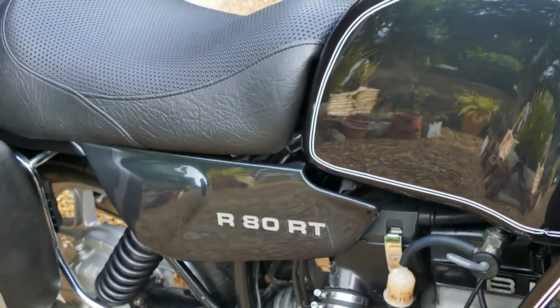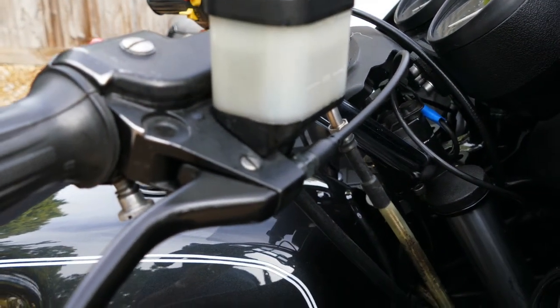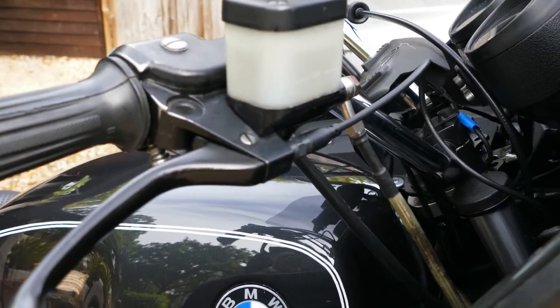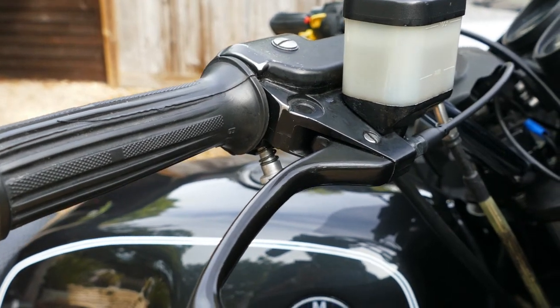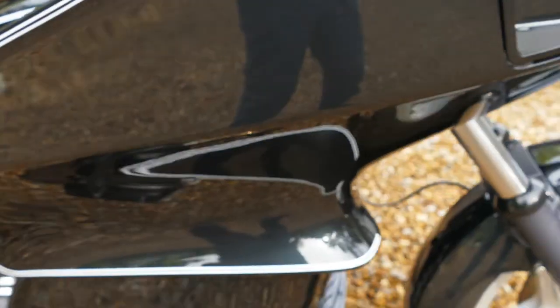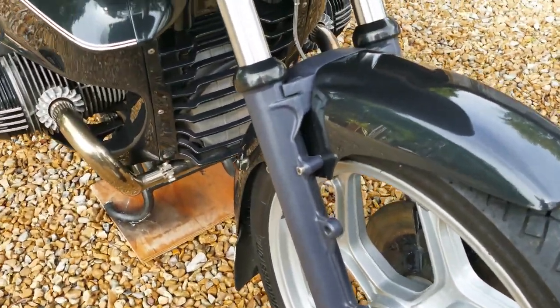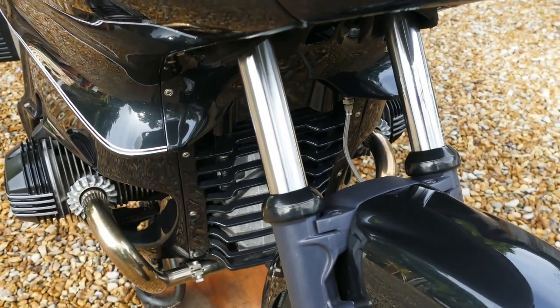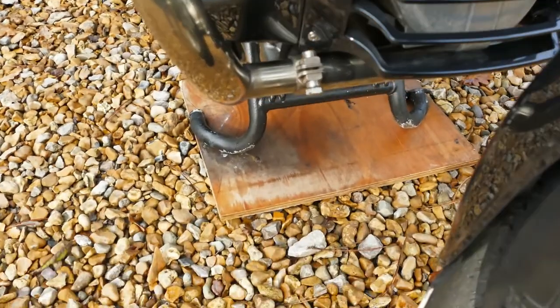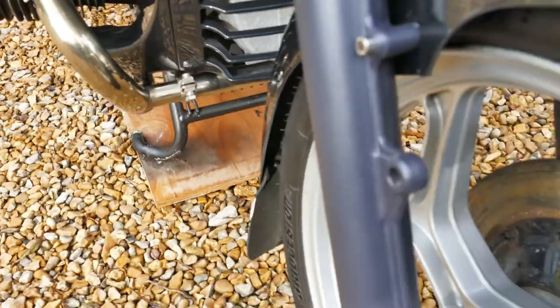A new battery. New rubber at the top of the reservoir and o-ring where the reservoir sits on the body, and kit on the master cylinder piston. New progressive springs — that's why I took it all apart in the first place, to change the springs. And yesterday I put seven and a half weight oil in. I got rid of the brand new 10 weight — it was just too heavy for English roads. It's all right in the real world on the continent, but over in this third world country it's really uncomfortable.